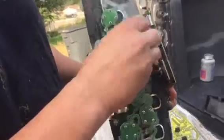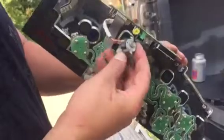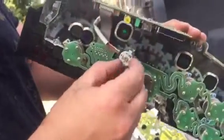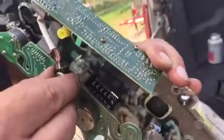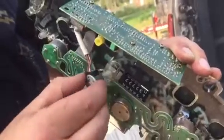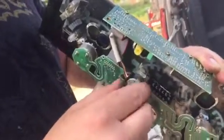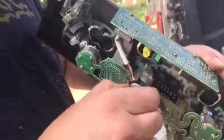So this little motor — there's a little plastic lip there, and a plastic lip that those little pieces get stuck under. So to get it out, I had to bend those metal pieces down, and I'm hoping that I can in turn bend them back. Once you get those out of the way, one thing you're going to have to be careful of is not to break those little ears off, because those are what's going to hold that motor in place and ensure that your gears actually mesh.